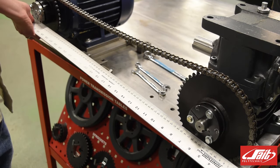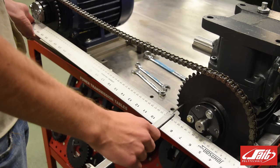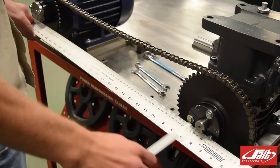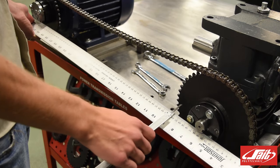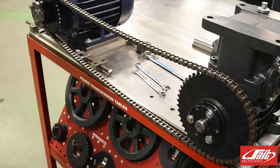we're going to place our straight edge on the hub of the machine we just measured, and then take the caliper at different points of the sprocket to make sure that the distances are the same. We can see there that the sprocket is a little bit misaligned relative to the straight edge. We need to make some adjustments on our motor.